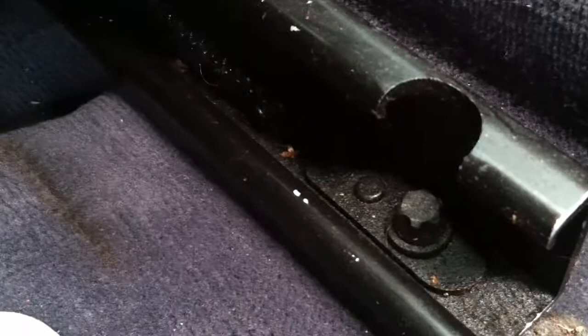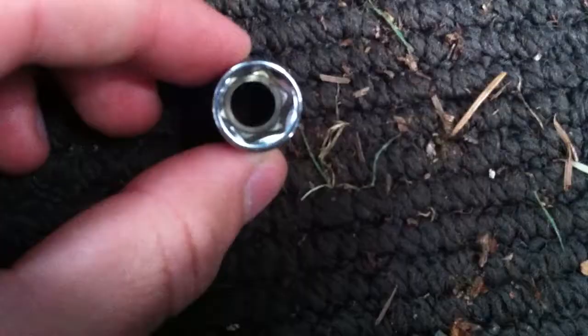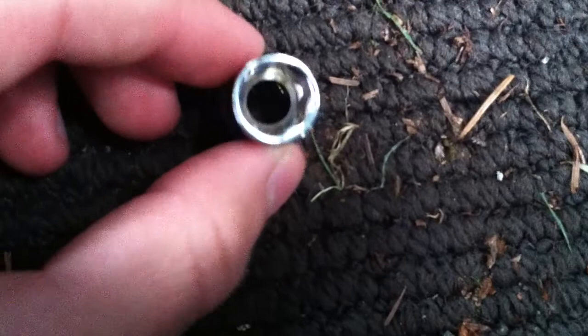The first thing we're going to do in the back is remove this bolt right here and this bolt right here. The weird thing is these are star shaped — not your regular sized bolts. If you have a 12-point socket, it might work; it's going to be a 12-point 11-millimeter socket. I actually have an E13 style — it's got the star shape in it, fits right on top, pretty snug fit. I'm going to remove these two bolts real quick and we'll go from there.